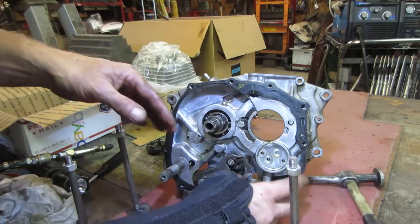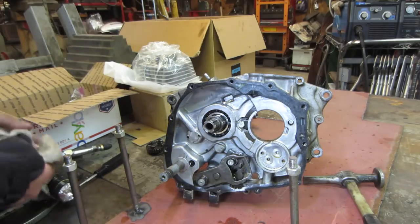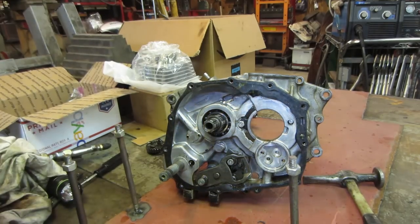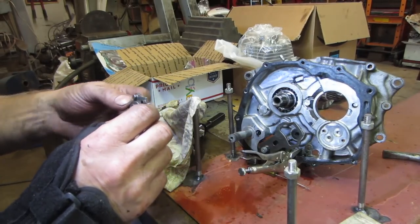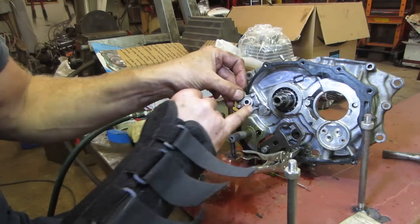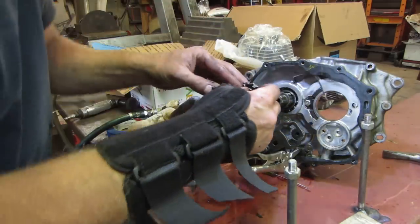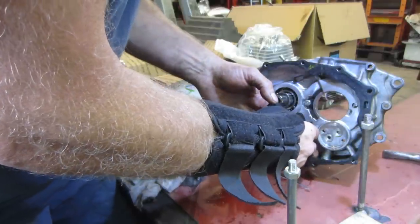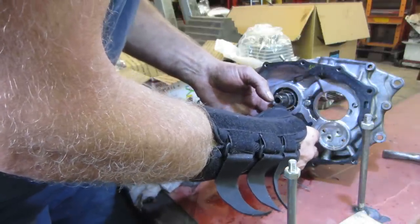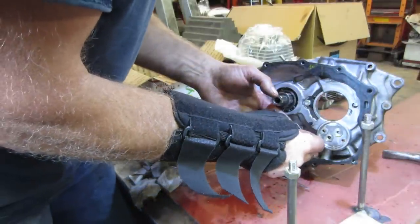All right. Now, see if you can push that cam down. Get that started again. But I have to do that where you guys are, so you're going to miss that part, I guess. All right, I got a pair of needle nose vice grips holding that spring-loaded arm off the cam, and I marked the pin with a marker so I can see where it is, and then I marked it up there so I can just kind of try to get the orientation correct. That's where the pin is. Where's my bolt?